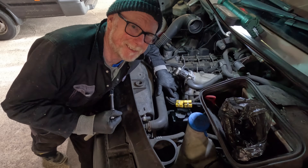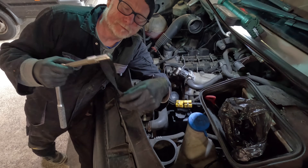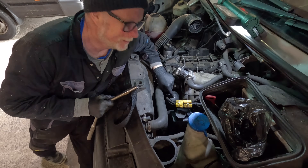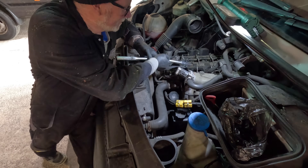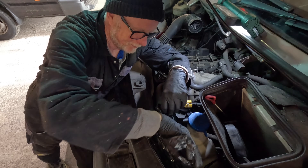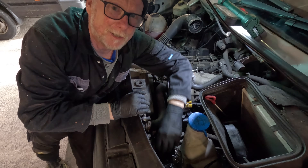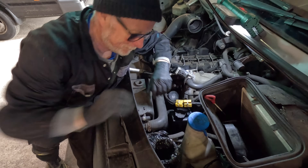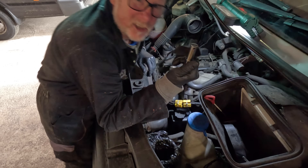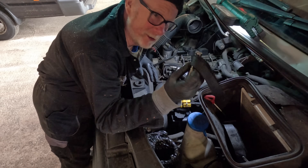Here's the oil filter. The oil filter is underneath this plastic cover and to remove it you'll need one of these straps - you can get a special tool made by Mercedes but this will do just as well. Now when I get this out, the filter inside isn't like a car filter, it's a cartridge filter. It's going to be covered in oil and that oil is going to drip and go everywhere. So what I do is I get a doggy poo bag, place it inside where the air filter pipe once was - this makes like a little cup inside there. So when I take this out, I can put it straight into that doggy poo bag and it's not going to make any mess. These are really cheap and you can save yourself a fortune by doing this yourself - it's a really simple job. I will put a link in the description if you're interested in buying one of these.